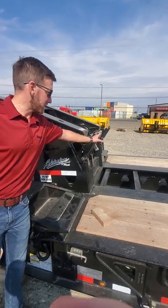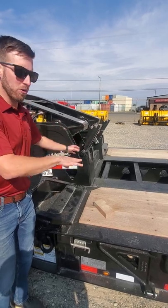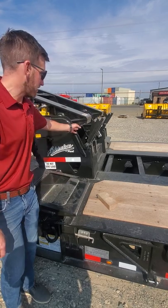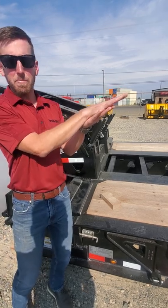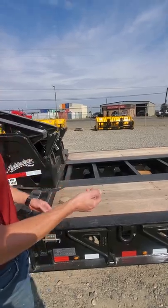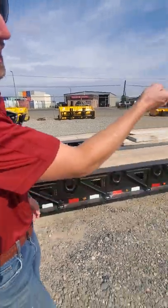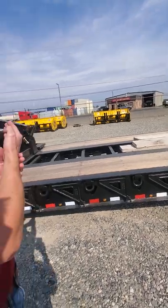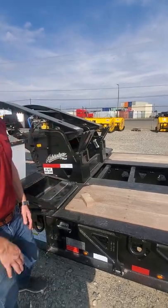Your multiple ride height doors — this is your main transport door here. You're going to pick one of your five settings; each setting is about three-quarter inch difference from raising and lowering the bed. When you're empty, if you have your lift axle up, you can use one of the lower two settings to drop the front of the trailer down, which will raise the back up higher and give you more ground clearance off your lift axle. That'll help prevent any scrubbing on the lift. The trailer is blocked similar to what the ride height would be, and you've got about three-and-a-half or four inches of ground clearance as it's sitting.